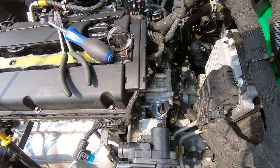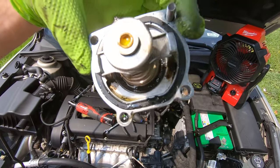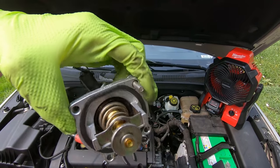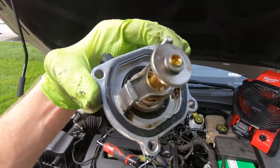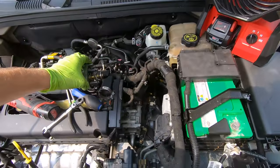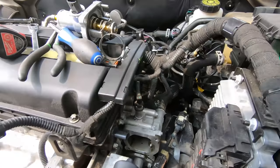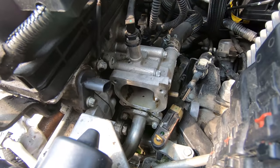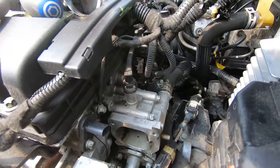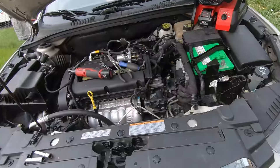That looked like oil in that coolant — might not be, but just something I figured I'd update you on. There's a little bit of worry for me there. You can see where it just kind of sat up around that high level — that's probably where the coolant was last night. I'm going to get a new thermostat or at least a gasket — this gasket is shot. That's definitely where it was leaking from. The coolant is a little concerning — you can see it sitting in the thermostat housing on the edges as well. Has this been sitting for a long time? I just don't know.